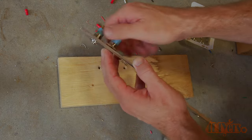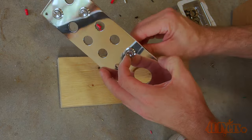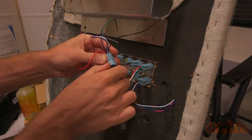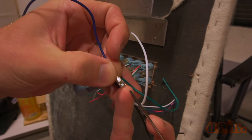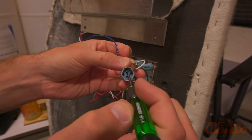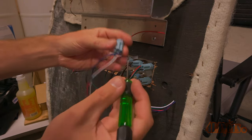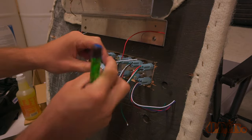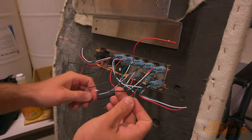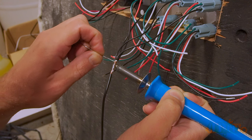Moving on to the wiring for the switch panel. These are illuminated switches — I'll wire these so they illuminate when the circuit is active. Once the circuit is active the red LED ring around the switch will illuminate. These switches have two circuits: a normally open and a normally closed. To keep everything cleaner I remove the normally closed wire as it won't be used. For these particular switches they had a wiring diagram on their website. I used a small screwdriver to disconnect the pin and pulled the wire out from the back side. I'm using OEM Tools 22560 precision screwdriver set — made from chrome vanadium steel with magnetic tips. Once all the extra wires are removed, all the ground wires for the illuminated LEDs are twisted together, soldered, and heat shrink is applied. This will connect to the ground terminal on the new fuse box.